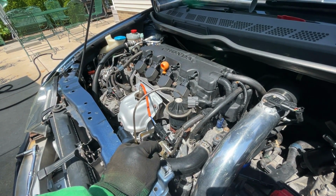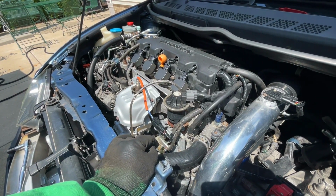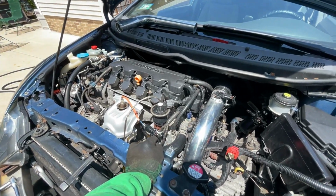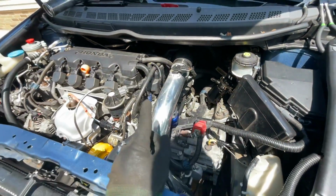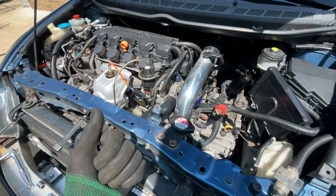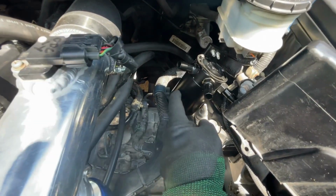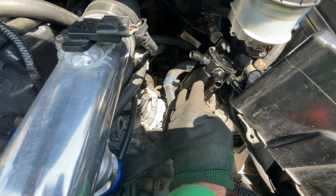so they don't deposit in the engine and don't dilute my engine oil to be thinner, especially during the winter when you have a lot of moisture. This oil catch can was filling up like crazy. So I think by doing that, we got an efficient system that's gonna work all year round. The only thing after that is just keeping a tab on the oil catch can, and making sure that when it fills up, we drain it.